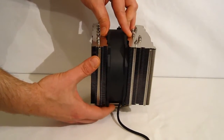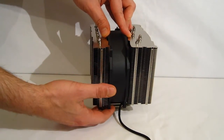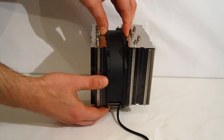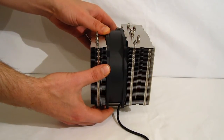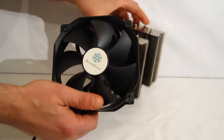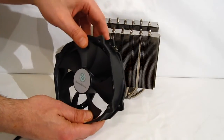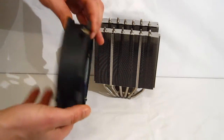That's important as this fan is 500 to 2000 RPM PWM and is capable of up to 171 CFM, all keeping it under 43 dB. Obviously that is going to be a little bit loud at 2000 RPM, but 171 CFM is going to be moving a lot of air. The Silverstone fan has a performance and quiet switch on it. The quiet mode will cap the RPMs down to 1200 RPM, keeping it much, much quieter under load.